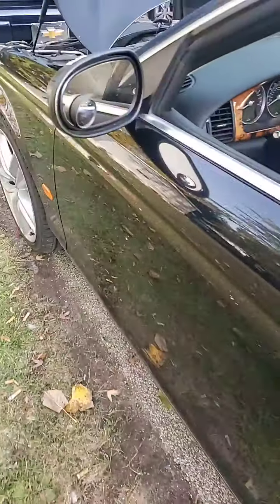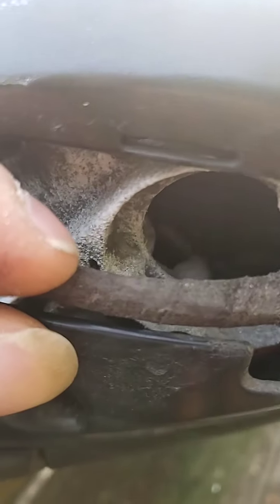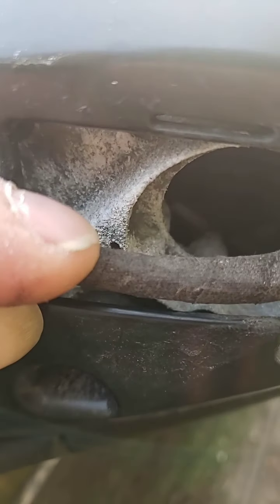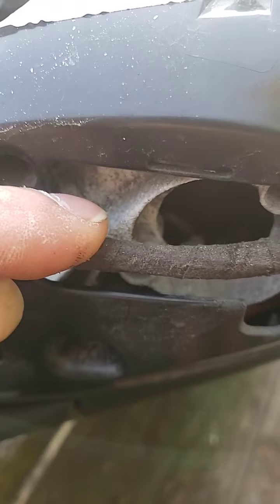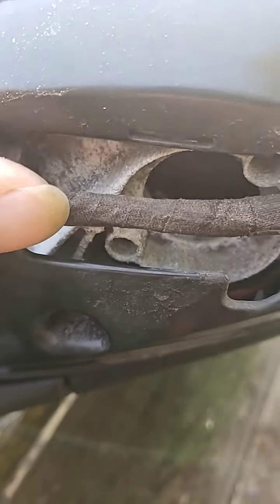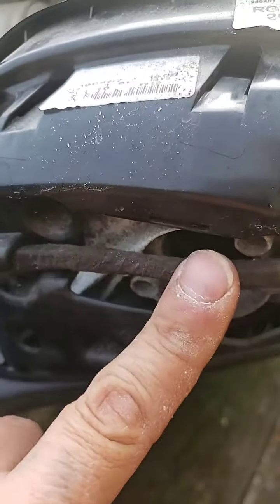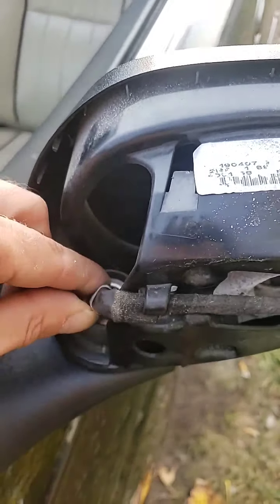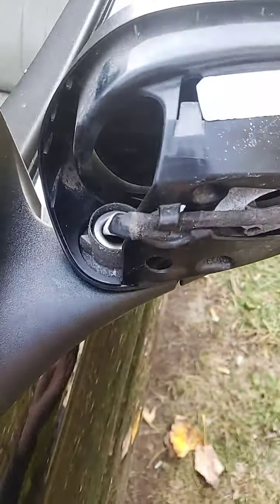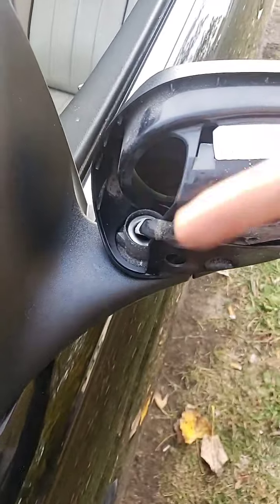I'm assuming that most likely it's corroded. See how corroded and bad that is? The motor's probably not really bad - the mechanism is probably just seized up from the corrosion. Some lubricant and some working it will probably get it loose and functioning again. Maybe it's corroded and backed the wire harness out that plugs into it - that's a possibility. Any number of things, but I'm going to have to investigate it. It all has to be done from the other side guys. That's what I'm looking at - that's what I'm checking out today on the Jag.